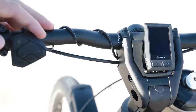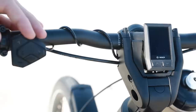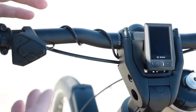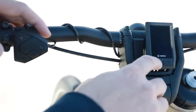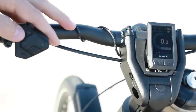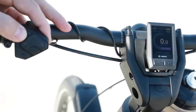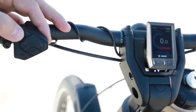The Charger 3 is available with three different display options. By default it comes with the Intuvia display, Bosch's most popular display, showing basic information. This bike has the Kiox display as an upgrade. To turn it on, tap the power button. By default it's in off mode, but you can change the assistance level using the plus button. Eco mode is 60% assistance, Tour is 140%, Sport is 240%, and Turbo is 340% — up slightly from the previous Generation 2 Bosch motor. The display color changes as you change the assistance level.